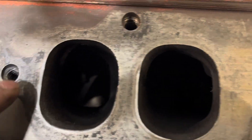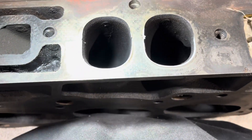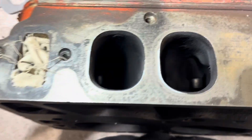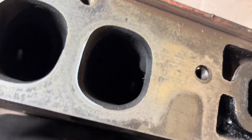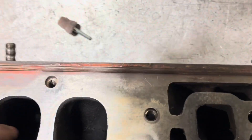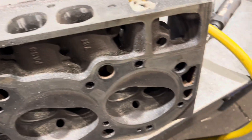So I've got them marked off for that lip — how much bigger I can make them. It's kind of hard to show up on camera, but yeah, that white line is how much further I can go, elongating them and making them wider. The main work is going to be done on the inside of them — just freeing up anything. Right here, you can see casting marks and they're really sharp, so I'm going to get rid of that. Open it up, and then bob's your uncle. As you can see from the amount of metal shavings, we've attacked it pretty good.